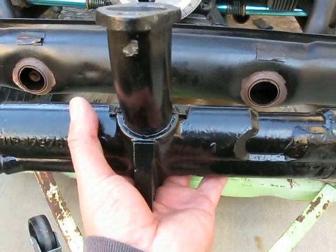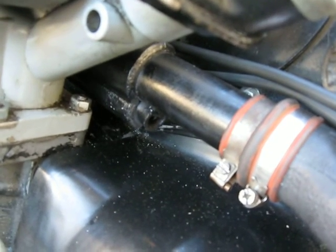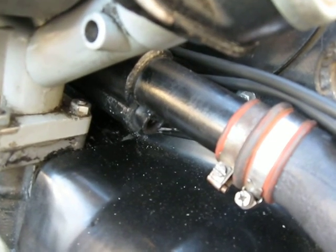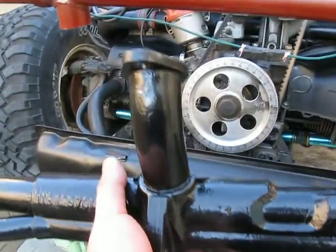The thing is this was made for a 1300cc dual port — will it matter if I put it on a 1600cc dual port? I hear the H30/31 replacement carburetors can be mounted on these manifolds with an adapter and work pretty good on 1600cc engines given they're jetted right. But the runner outer diameter is a little smaller on this manifold. Would that starve the engine, given I do correct jetting?